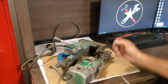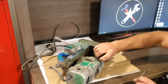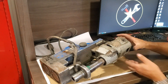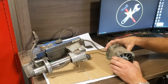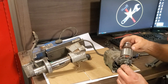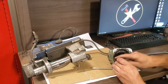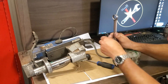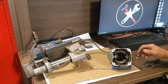Then I remove the small access cover from the front of the drill, then remove four screws that hold the motor in place. I gently pull the motor off, then carefully pull the armature out. Next I remove the two screws that hold the stator in and remove the fan shroud. Before removing the stator, I loosen the strain relief to free up the power cord, then slowly work the stator out of the motor casing.